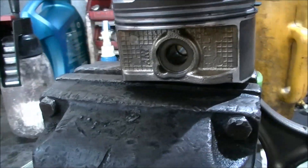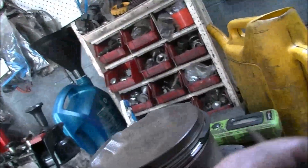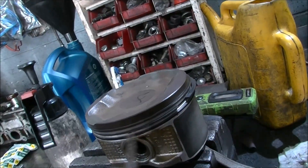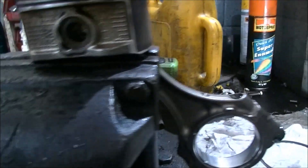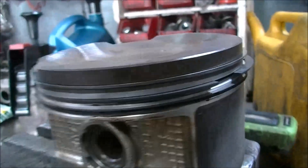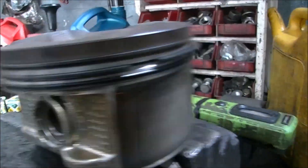If you know me and your old OG, you know that I like to flood - plenty of oil in there, plenty in the cylinder, plenty on the rod bearing, plenty on the crank. As much oil as I can as I'm putting it together. I'm going to put the ring compressor on now and we'll pop him in the hole.